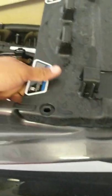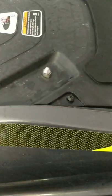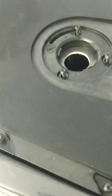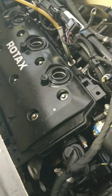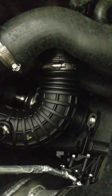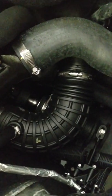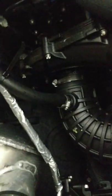The first two bolts on this cover have nuts at the backside. The rest also have nuts on the backside, but they're actually held in by the upper hull of the ski. I'm just going to remove this — go around it and unscrew all the bolts, then lift it right off. Now that it's lifted off I can pull out the last module and then move on to taking out all the spark plugs. I'll also make sure all the bands I can get to are tight, at least to spec — sometimes they come loose over time — as a courtesy to give the owner every opportunity to enjoy this ski.